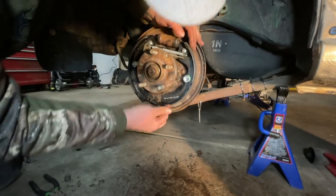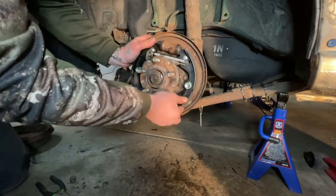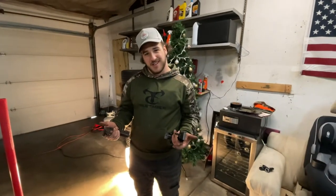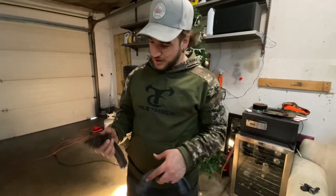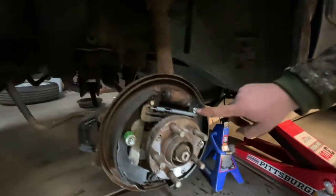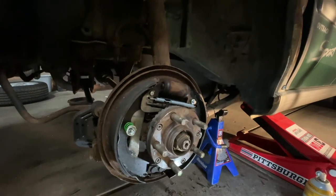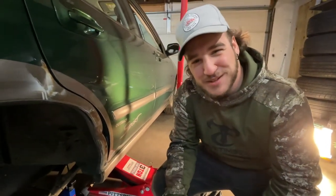Why is it sitting so low? Why are they sitting super low — look how low these are. The way that they packaged the shoes, both rights were together and both lefts were together, and so I took a set of two — essentially the backsides, so lefts — and put them together. Hence the reason for my huge struggle. There is a pin going through one, there is not a pin going through the other. I have a set of two pins. Everything almost lines up perfectly down here, except for the fact that it wants to fall super low. In theory, this is what will solve all my issues. You win some, you lose some.